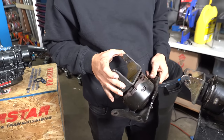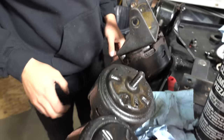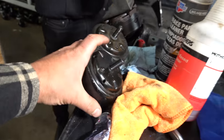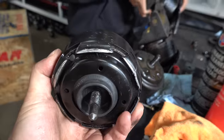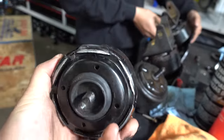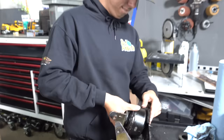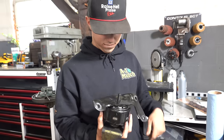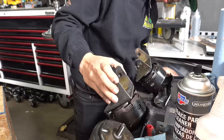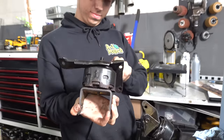Get that figured out? No. All right, Barb is out getting valve cover gaskets, and the two of us are trying to figure out how to get in these Super Coupe upgraded engine mounts. This is the upgraded one. That's the old factory one. Those are hydraulic. These are solid rubber, so they're much stiffer, and they're gonna take way more abuse. If we can figure out how to clock them in there. Yeah, keep spinning it. That'll help. It's like a helicopter. Should put a motor plate on it. That one says L. Is that good? Taking a big L here?